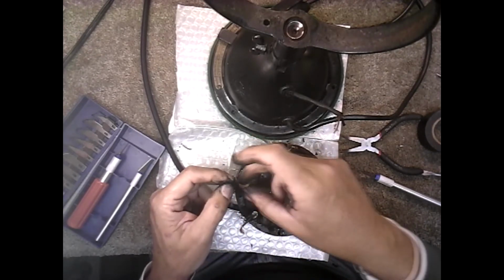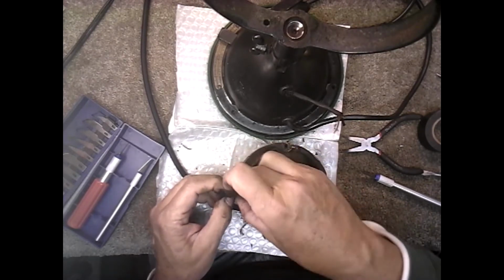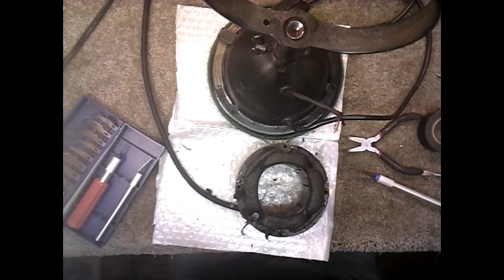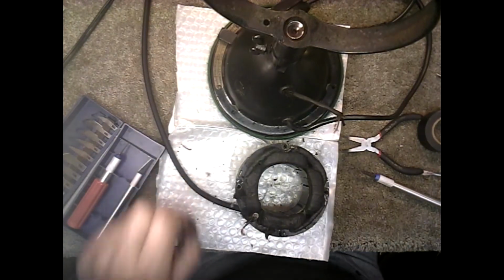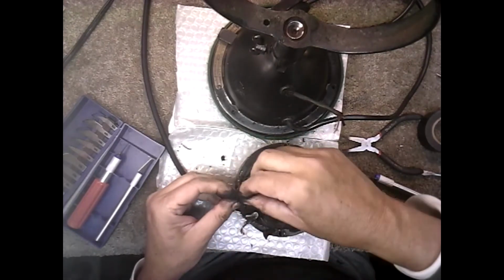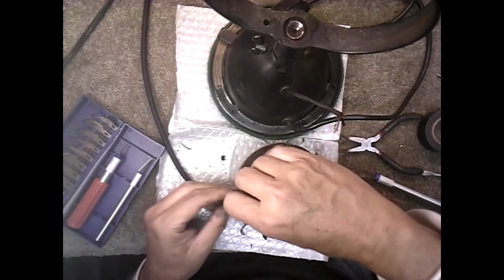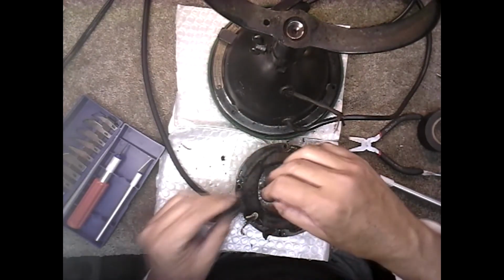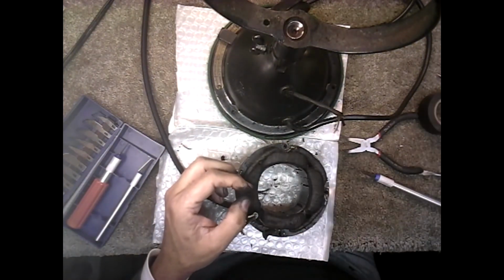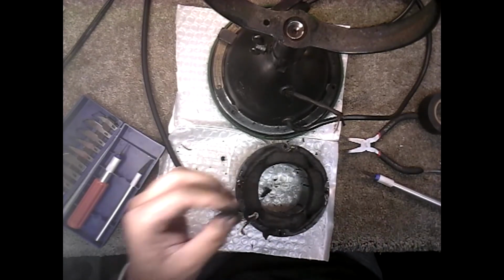So this is where it was soldered. But I'm going to try to take a little bit more of this off because I'd rather have heat shrink than this gummy stuff. It's deteriorating anyway, and we don't want it causing a problem down the road. Okay. I'll go ahead and get this connected, and then see, there's the wire, and I'm going to put heat shrink right over that one. That one came out in bad shape, so let me just cut it here and slide that right off.